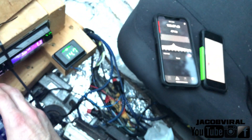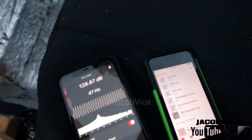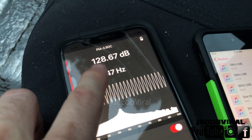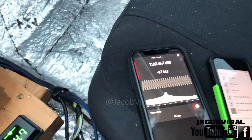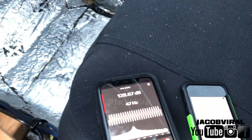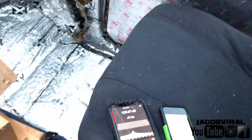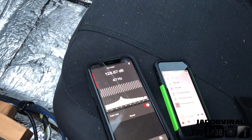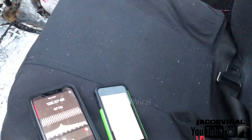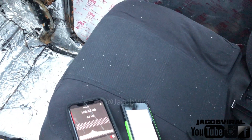Alright, so 47 hertz. That looks like a loss already because I'm at 28 dB, where before I was at either 29 or 30 — I don't remember. We shall see in a minute. I'm going to guess I lost, but hey, I hope I gain. We shall see. We're going to burp at 48 hertz — I always burp one hertz above where it peaks because that's just how my truck is. Let me go ahead and get it rolling and we'll find out.